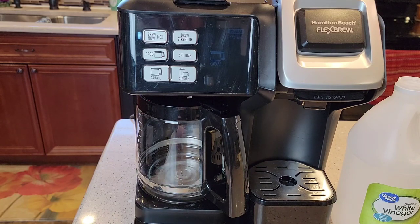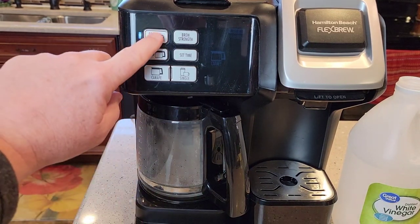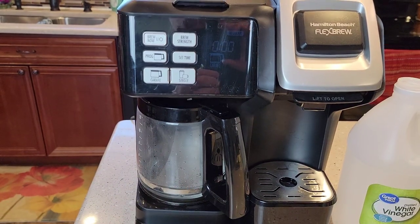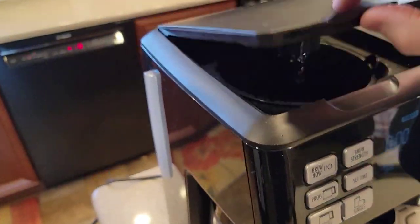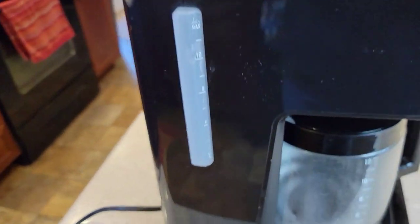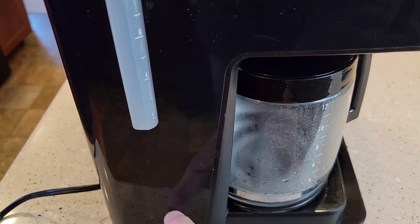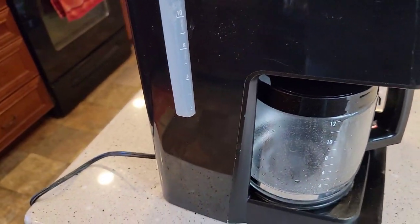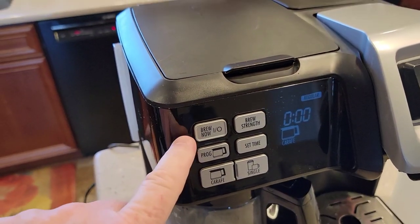The vinegar is starting to come out. You can wait 30 seconds to a minute — that's fine. So it's been about a minute. I'm going to turn the coffee maker off so it's going to stop brewing the vinegar. The vinegar is going to remain in the water reservoir. Down in your heating element, it's going to be all covered with that vinegar, and that vinegar will soak on that calcium and kind of break it up. So when we turn it back on, we're going to wait 30 minutes, then come up here and turn it back on.